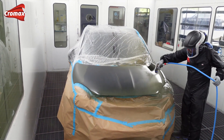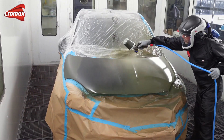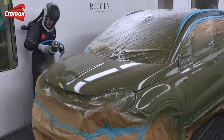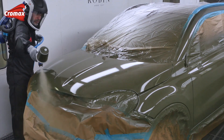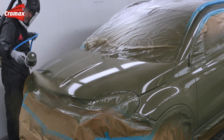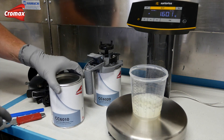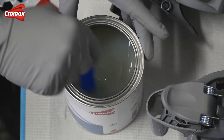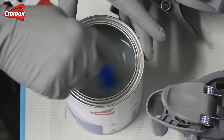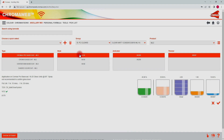If newly applied base coat has been overcoated with a normal gloss clear, this must be thoroughly dried, sanded, and cleaned prior to overcoating with the matte clear system. Please refer to the dedicated matrix table for the appropriate mixing ratio of the matte clear system when used on sanded old or original paintwork or clear coat. When preparing the clear coat for use it is simply a repeat of the correct combination of the two clears identified when you made your spray out cards. Stir the material thoroughly before each and every use — note that the can is deliberately under-filled so you do not lose material over the top during stirring. The colour software will guide you through the required mixing steps, which helps with accuracy and reduces mistakes. Using the colour software and weighing across the scale is strongly advised.